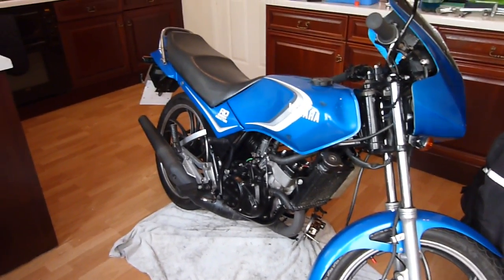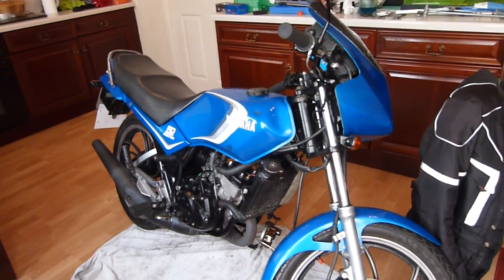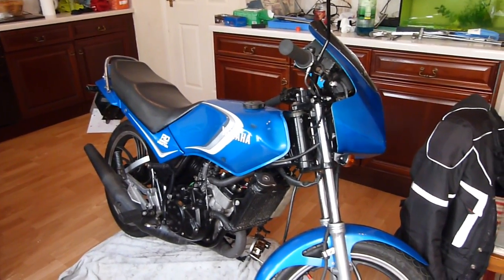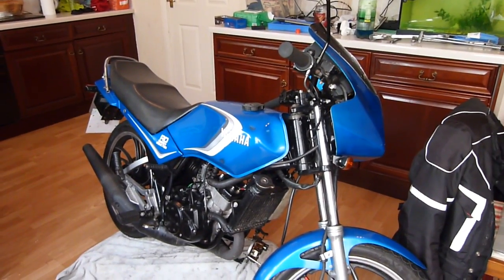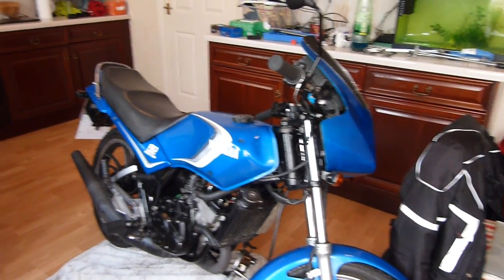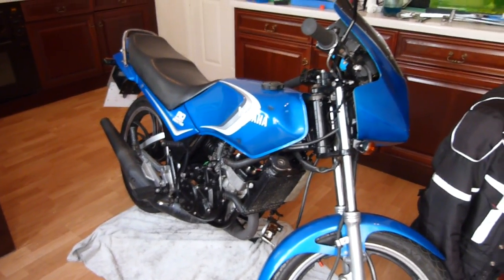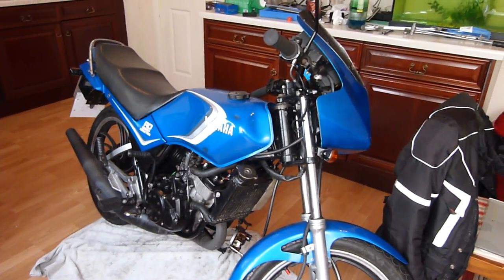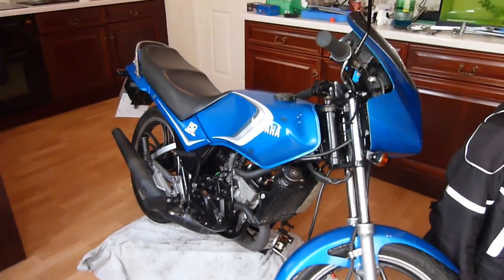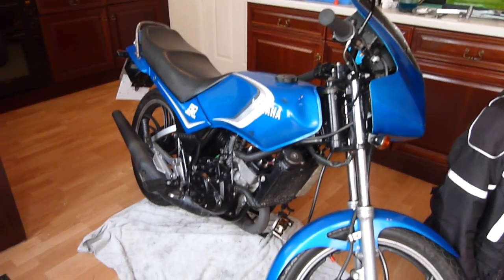The reason I did this was a few issues. The bike was running and running quite well, however there were a few little issues. One — it wouldn't idle properly. After you'd been riding it, it would sit at around 2000 RPM constantly. When you went to drop the RPM down using the tickover screw, it would just dramatically drop off and you couldn't get any kind of stable tickover, which is a classic air leak problem that two-strokes are prone to because there are so many places you can get air leaks on them.